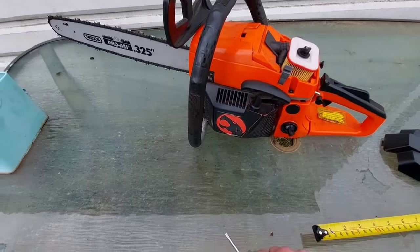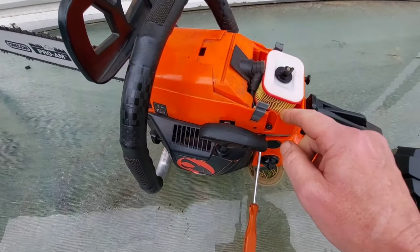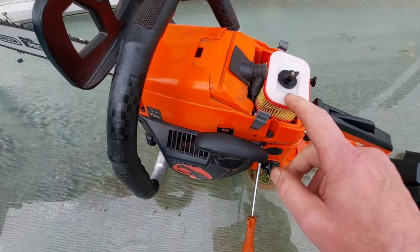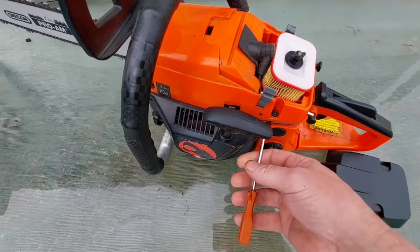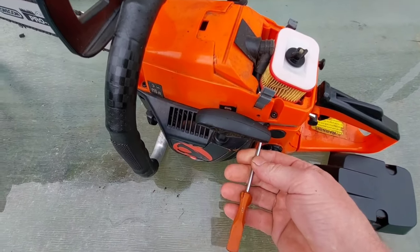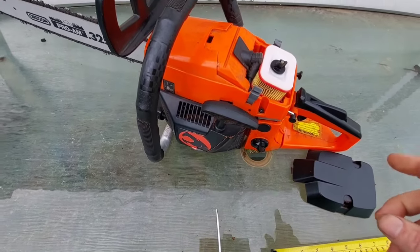So the screws for the carby, they're plain head screws. You've got to find your way in there. Look down in there. You've got to tune with the air filter on, preferably with the cover on too, but you won't be able to see. Very difficult to get to, but it's tuned for what I've got here, as you've seen in the video.